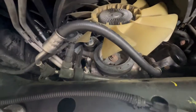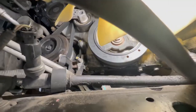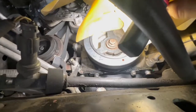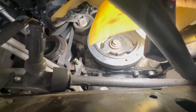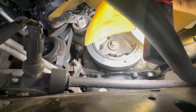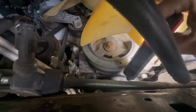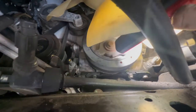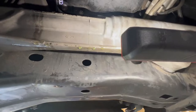And then you can take your light. Once this got hot, it was harder to see. But if you look right inside the harmonic balancer over on this side — when it's cool, you can see the stream coming down. Once it got hot, it evaporated right off of that front cover. It was actually getting on the harmonic balancer and then slinging down here. And of course it would drip off the bottom, but it was spinning around so you weren't seeing it on the front cover. It was only dripping right here at the front of the oil pan and onto the rack and onto the ground.